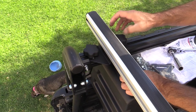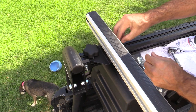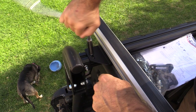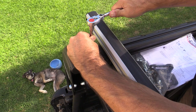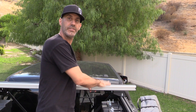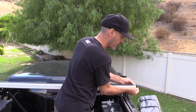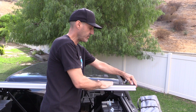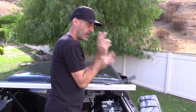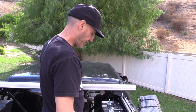Get started by simply removing the easy-adjusting fasteners on the rear crossbar rail and replacing them with the included locking nuts. Snug those down — and get a chuckle out of Pinto the dog rolling in something stinky down there. Make sure to get both sides of the crossbar mounts done. The front bar always stays locked into position; the rear is the one that moves to give you the flexibility to put a motorcycle or something tall in the bed of the truck. Once everything's locked in, pull the end cap off and pull the top rubber strip off — this cushions kayaks or other things and also helps quiet it down on the freeway. I've driven this and it makes very little noise at highway speeds.